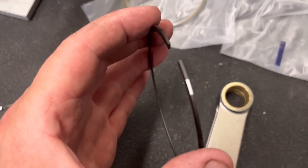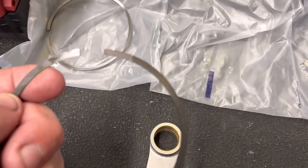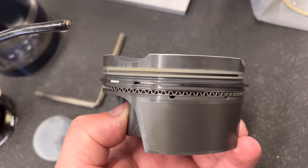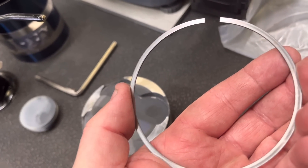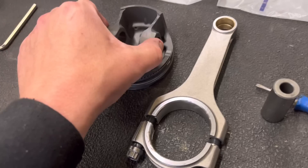So now we've got the top ring there, the joint is over there and around the other side you've got the bottom joint. Now we want to put the second ring on - usually depending on which way the ring goes up, on the scraper ring which is the second ring, if you have a look down the cross section on the inside you've got like a groove and that groove usually goes down to the bottom. And if I'm right it has got a marking saying 'top' - which it has, there - so that goes up the top. So we put that one on next. You can see that second ring's on there now and the top ring goes just above that - you want to be doing the same with the gap, put the gap sort of over the other side, probably about 120 degrees out the way of the second ring gap. And the same with this one - although this one is going to be a square cross section there's going to be a mark on the top, usually saying top or a specific letter - you see that's got an M so that goes up the top. Top ring's on about 120 degrees away from the second ring gap and that's the rings on.